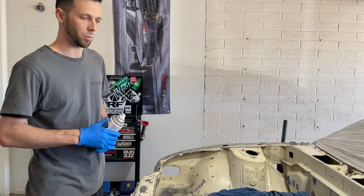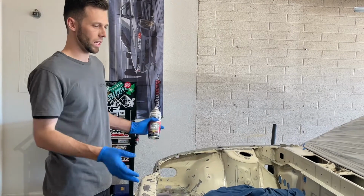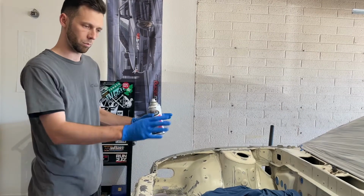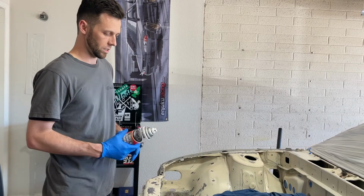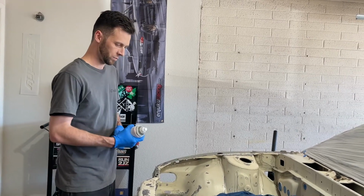A couple of the other prep techniques that we used. We used the mineral spirits to get all the oil out of there after we sanded it down with the red Scotch-Brite pads. If you have any questions about anything that we used to help prep the engine bay, leave a comment below or let us know if you found a better way to do it, because we're just experimenting with this. So here we go.